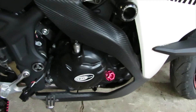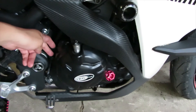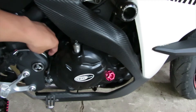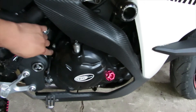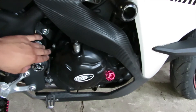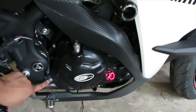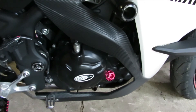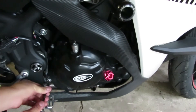In order to remove the oxygen sensor from this location, on this part there's a little clip — you can just move it open, so just put your finger in and pull on it a little bit. Don't pull too hard because you can break the tab. Pull it just enough to free the wire. Once you've freed the wire, all you do is loosen up this screw right here, which is a four millimeter allen key.